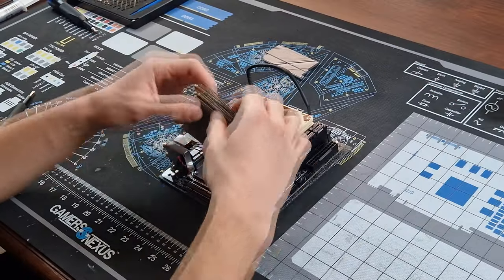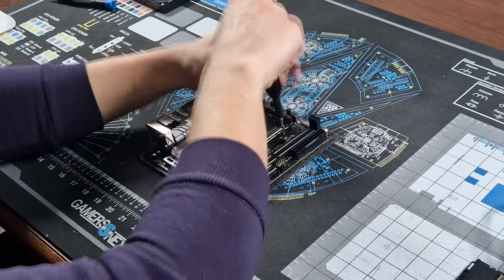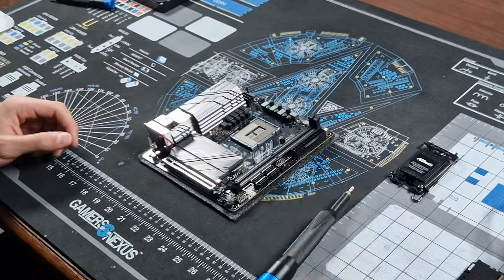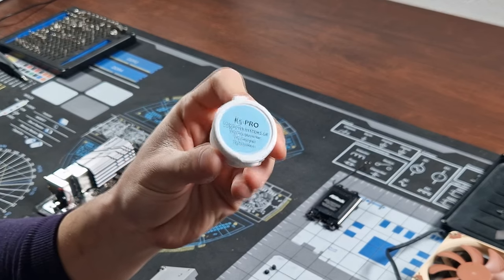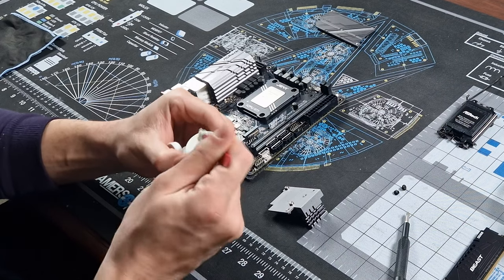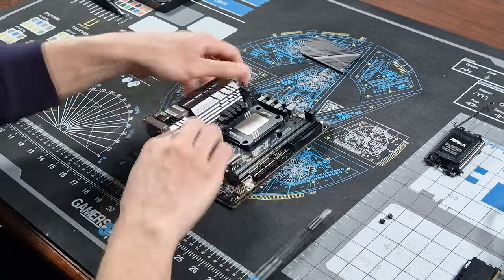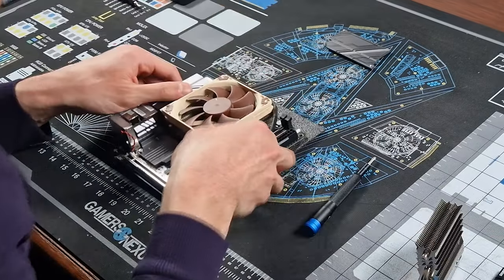First I cleaned my workspace and unpacked everything. The plan was to assemble the main components and test if they work before proceeding to build in the case — a smart approach to avoid finding out later that a part isn't working. I began by working on the motherboard, which involved replacing the stock ILM with the one I purchased, then installed the CPU. I also replaced the thermal pads covering the motherboard chipset with K5 Pro, a thicker thermal paste used as a replacement for thermal pads that offers improved performance, though it's quite messy to apply.